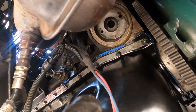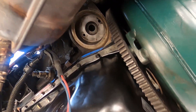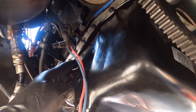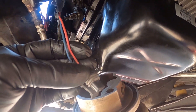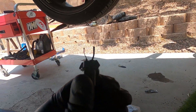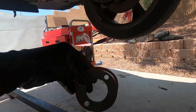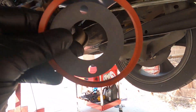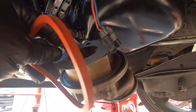106 inch-pounds for those, and 15 foot-pounds for the half-inch bolts — remember that. All we've got left is to put that level sensor in real quick. I went ahead and put a new connector on the level sensor as well, so we put a new one in there. We're also going to put that onto the Felpro kit.